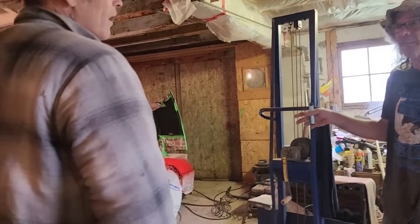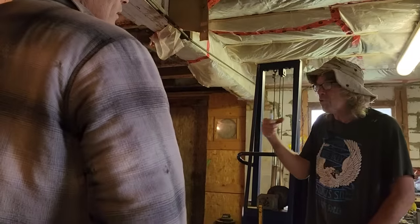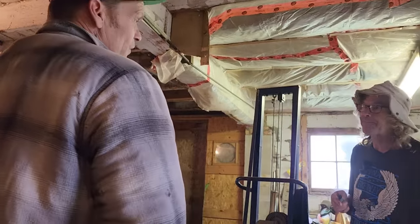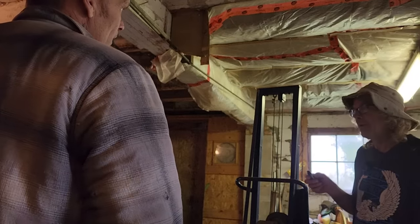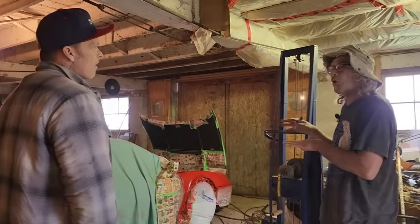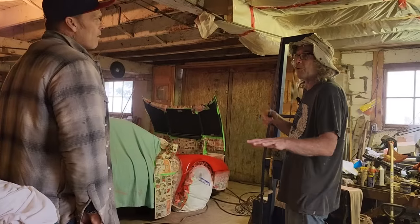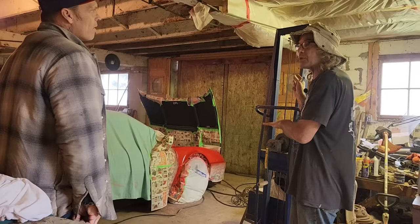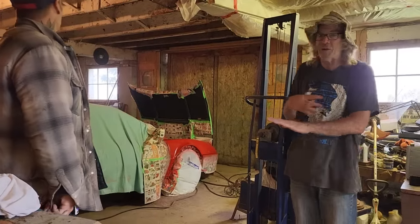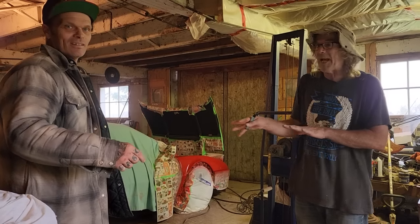And matter of fact, it's almost impossible, unless you get the flow perfect, to do it so that it's not orange peeling. Temperature means a lot, too, the right temperature in your room so your paint will flow. What's real bad is if it's warm and you've got a good second coat heavy, ready for your third coat, and then it drops 10 degrees and the air blowing in freezes, gets cold. The next hour it's cold, it'll soften what's already set up, activate it back up, and then you have sags.